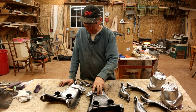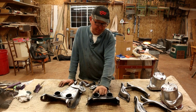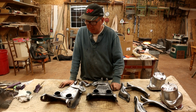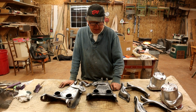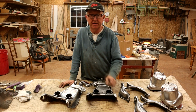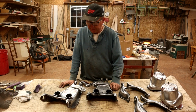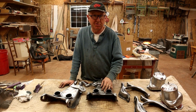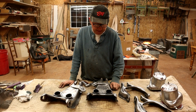The lower control arms come up nice. I removed the little mushroom bungs that sit in here. Only one of them was really badly split, so I only need to replace one, because the other 3 are in perfectly good shape, and there's no reason to replace them if they're fine. They seem like they've almost been replaced not too long ago, because they're such pliable rubber, and they just seem to be fine.